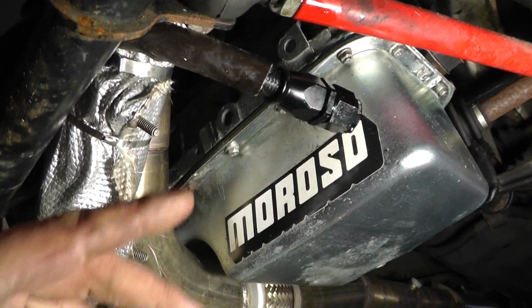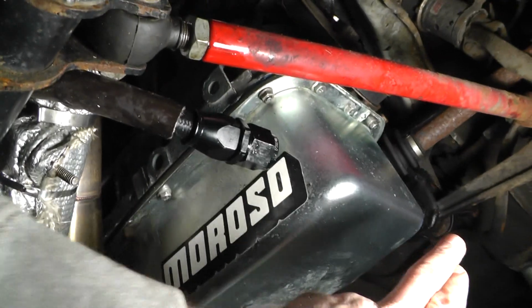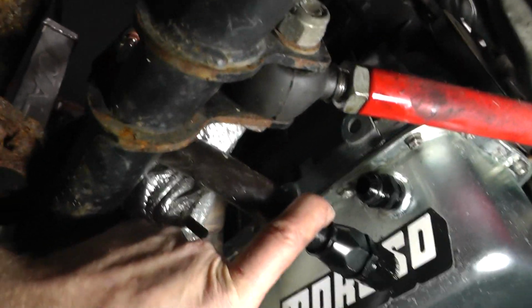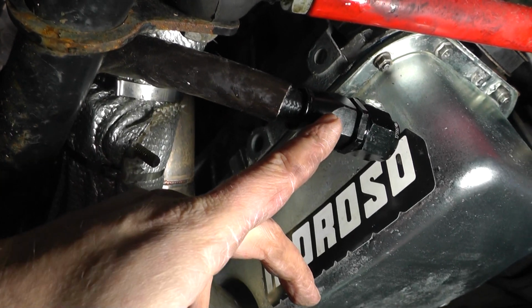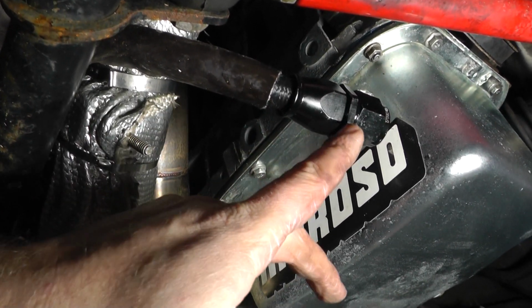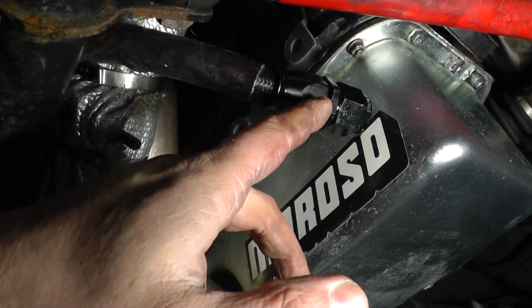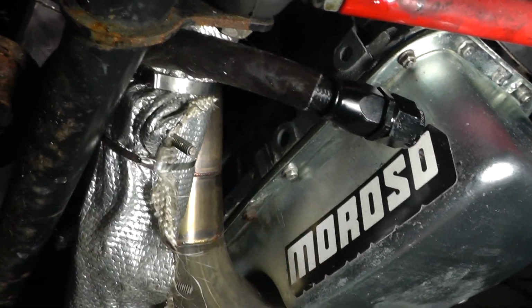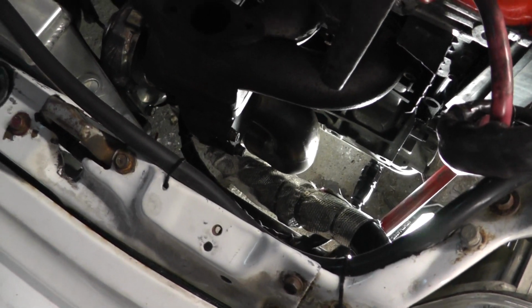So nearly there. You remember from before it was a bit of a mess down here because I think this pipe wasn't tightened up fully, so I've just checked the sump plug at the back, that's still tight. This adapter is still tight. It was actually just this collar to this wasn't tight, so I just did it up a little bit more to the flat again, so it was around there, tighten up to the flat, and that's it, that's all done. Now I can just place this back in here for the drain and then go up to the top of the vehicle again. So that's the turbo oil drain all in.